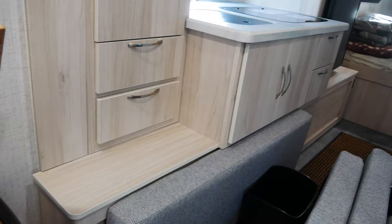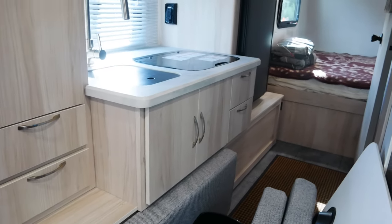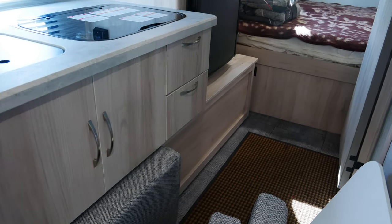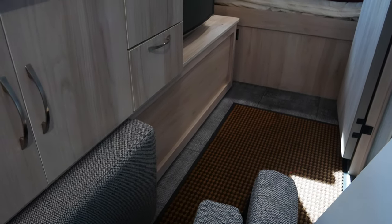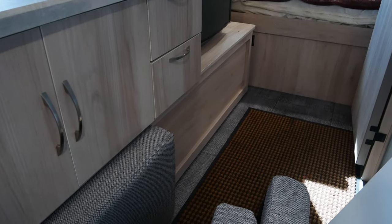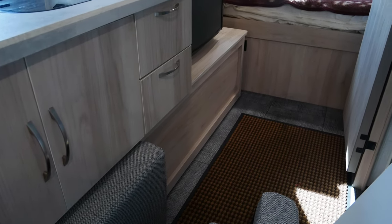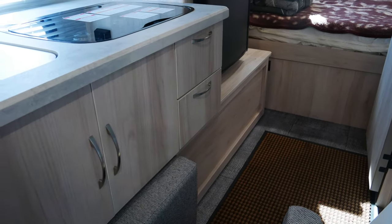So for those of you that are new to this trailer or not familiar, the location of the pump is basically between, you have to take that whole board out and screw the 5 screws and get into the water pump to pump the antifreeze through. And the pump location is just pretty much under the first 2 drawers on the right hand side.